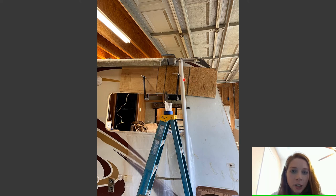And then I took some really big pieces of wood with my U-clamps, my deep throat clamps right here, and I clamped it that way. Just because I needed some more clamping points up here, and it didn't really work with the 2x4s because the 2x4s were actually clamped here and I needed to epoxy that area. So this worked really well. So you kind of have to do it in three different sections: the bottom, the middle, and then the top.